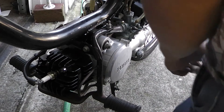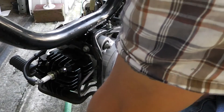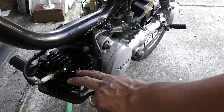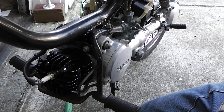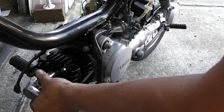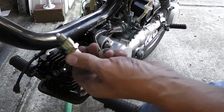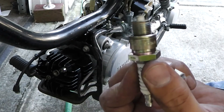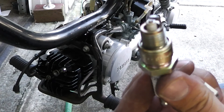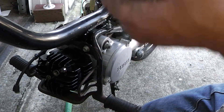Got this bike all washed up. Okay, so the guy says he tested compression, compression tested out, new spark plug, all this stuff — it's got the new top end, new piston, new rings. Never take a guy's word — ever. So we're going to remove the spark plug. The spark plug was only in there hand tight. That doesn't even look like it ran a minute. This is a two-stroke — that's a bad sign, because he said he rode it. That means it's not getting any oil in the auto-lube, so it probably burned itself up.